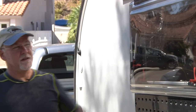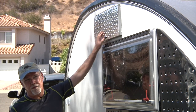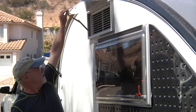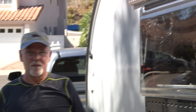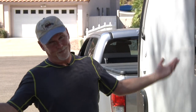AC is installed. We never unplugged it so there's no wiring or anything else to do — just clean up. Everything's caulked up and it's going to dry. The simple operation to remember: make sure you open this before you run your AC unit, because all the hot air from the compressor has to vent out of there — it will overheat your AC if you don't have it open. Just flip that open and pull it tight. Apply the weather stripping on bottom and top, and that's it. When you want to stop the draft at night, before washing the coach, when it starts to rain, or before you drive, go ahead and close it and pop your latch ring on. This does not need polishing — just keep it washed and waxed like the surface of the coach. Pretty easy install.